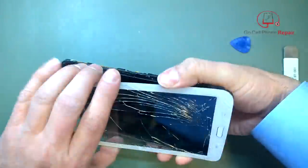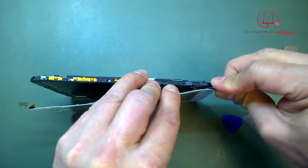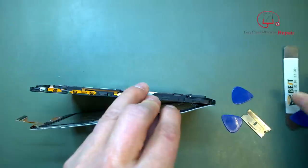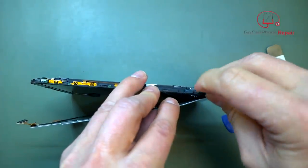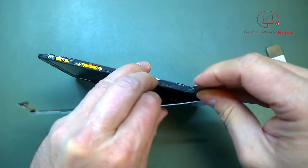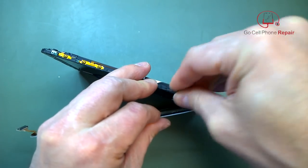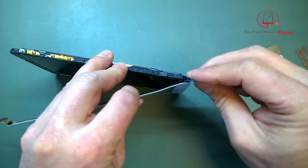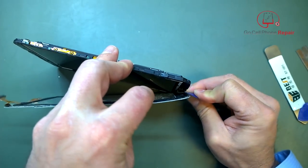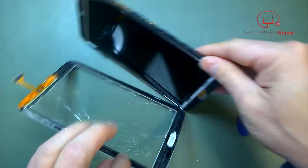I will put on some rubber gloves — I recommend you do this before you get anywhere near the LCD. The last thing you want is fingerprints on those, which are a headache to clean off. You'll see that this adhesive is very, very sticky — sometimes it sticks between the frame and the lens, which is why I've got the blade in there to cut through anything holding them together. Then I go down the front with a very shallow pry to get past the adhesive.